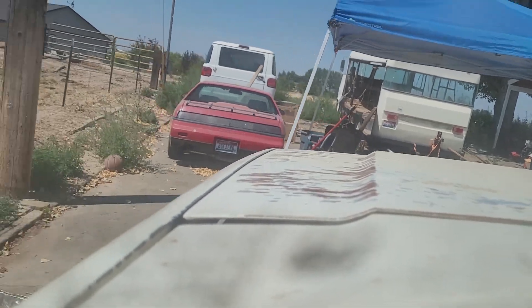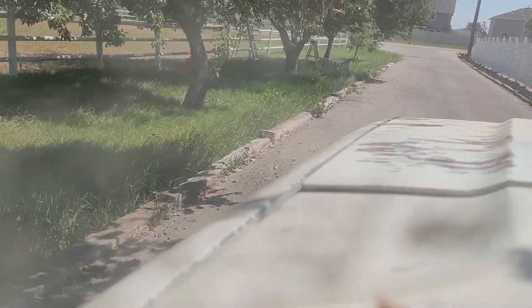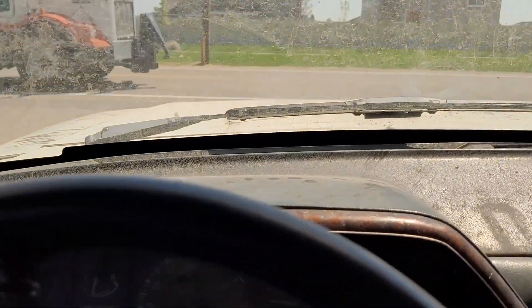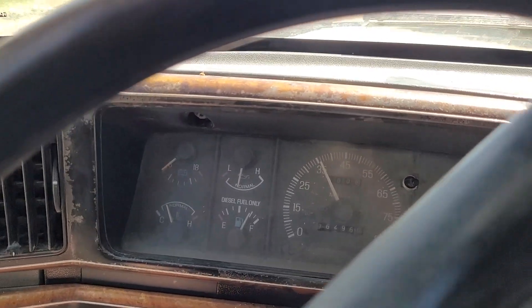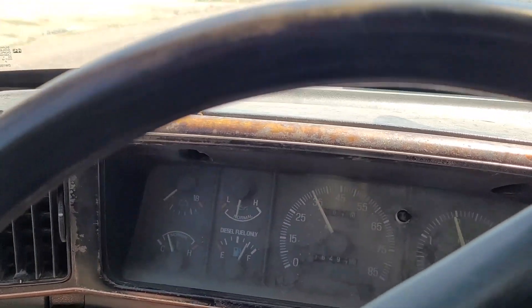Sounds like the belt's flipping a little bit for the power steering - it's squealing when I get it to the wheel lock. Well that doesn't grind into second anymore! Wheel alignment needs some adjustment. She downshifted into second without grinding, so that's a good sign. The speedo works - yahoo! I think the clutch is about as good as we're gonna get her - she's probably a little worn. A clutch job on this thing is pretty easy, you just gotta have a nice floor jack that'll hold up the heavy transmission. So yeah, speedo works, that's a win. We got the clutch all squared away on the Super Duty - it's not perfect but it's about as good as it's gonna get for a worn out truck. Next time we're going through the ZF parking brake, which is just a nightmare job. Stay tuned and I'll see you next time.